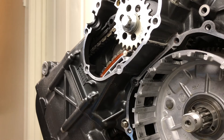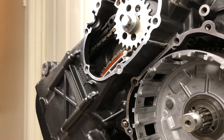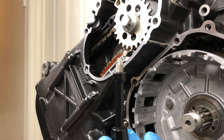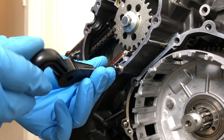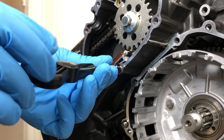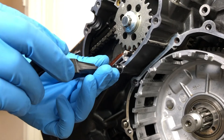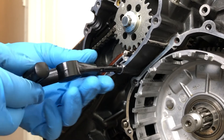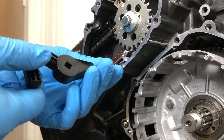Now we're going to take our coil. I know this is a common thing because this is the second time it happened, and I still have another one to do. I'm learning my lesson as I go and destroy the threads on my engine block. Now we're going to sit the coil on top and thread it in — going slow, making sure it's all the way down.